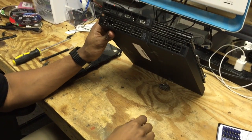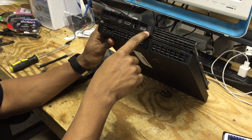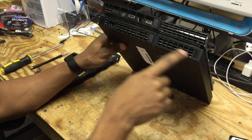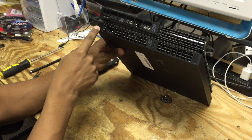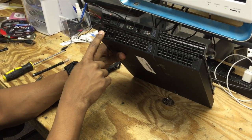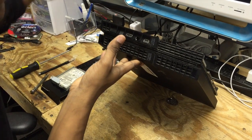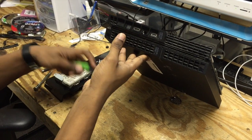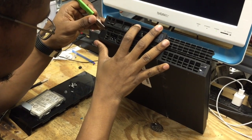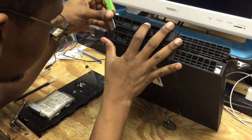We're going to look at the back of the PS4. You're going to have two warranty stickers here. For the disk drive you just have to take out the bottom one — there's going to be a sticker here and a sticker here. Once you take out all those stickers, there's going to be the security bits that are underneath them. What I like to do is take a razor blade and just get right underneath that sticker to get it off.